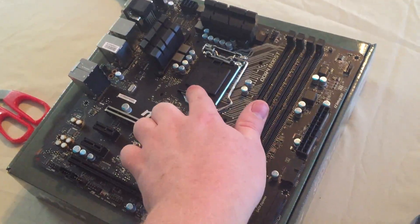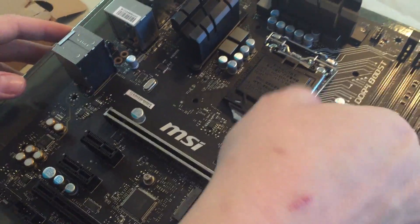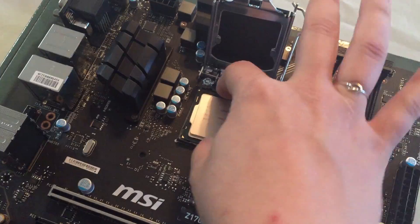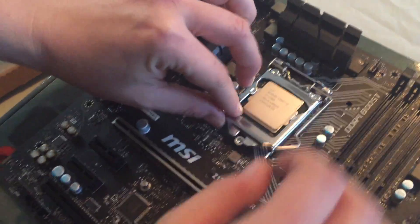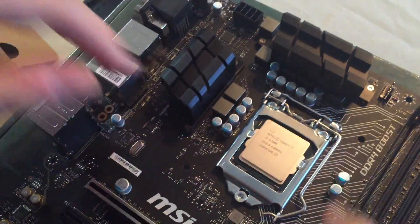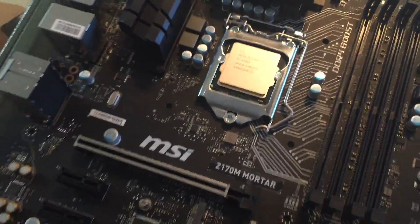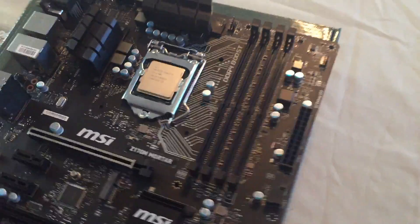Your CPU is going to go first. You should be able to just pull that little arm off, lift it up, and there's a little arrow on the corner — go ahead and lift it up and match that arrow. Drop it down underneath the screw and lock it in — perfect. That is the CPU installed. Next is the RAM — 16 gigs in that package, 16 gigs in that one, that's 32 total, which should be more than enough. Start with those two first. There's a little slit in the bottom of the RAM — line that up. You'll know which way it goes. Open up the little tabs first — this takes an uncomfortable amount of force.